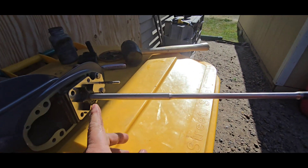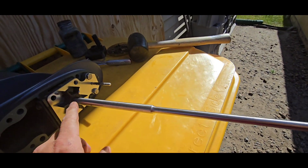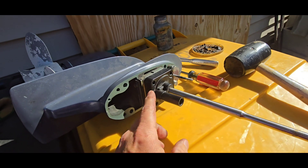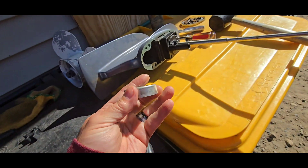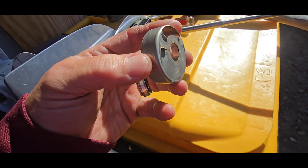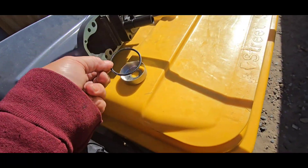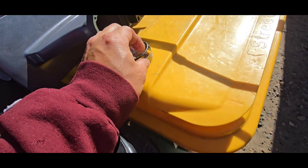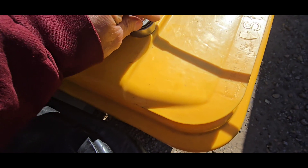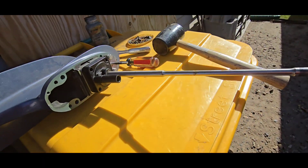You may find it easier to put some grease on the shaft and on the inside of the impeller — it's a tight fit. Make sure the key slides into the keyway. This piece will slide into the housing — there's a notch so it sits in one position and kind of locks there. The gasket has a little groove and will slide over this part. Then we've got our four new bolts to put in here and then we can put it back in the engine.